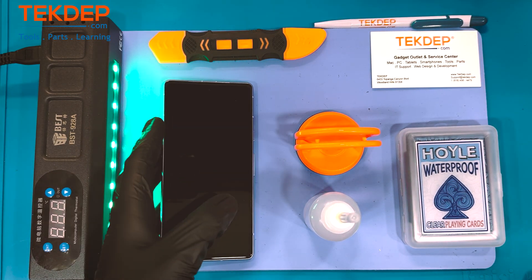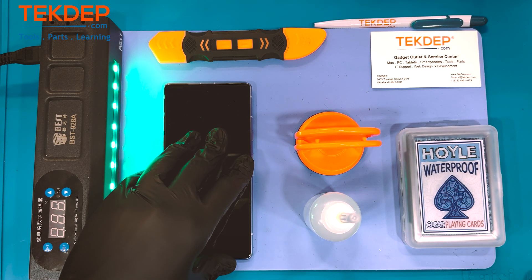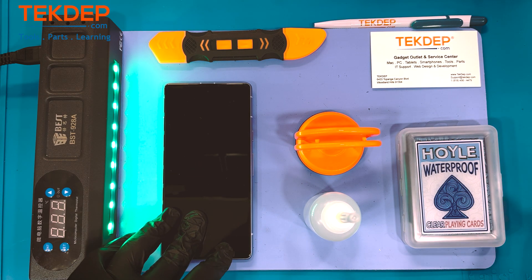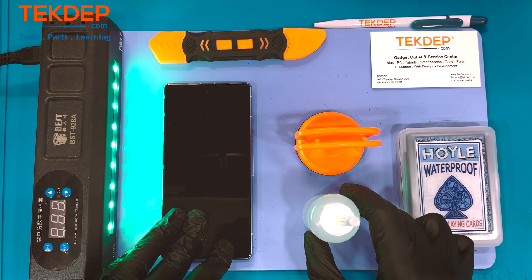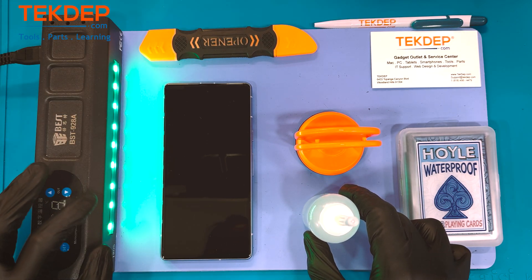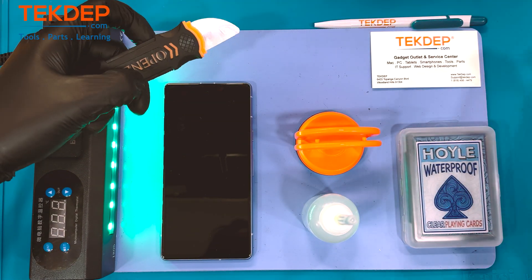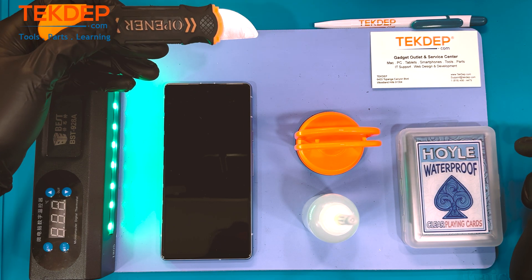There's a fragile screen, at least as far as repairability goes. The Gorilla Glass is pretty scratch resistant and pretty good when it's on the phone, but these OLED screens are finicky when it comes to getting them off without damage. So that's why we use the playing cards, the suction cup, the isopropyl alcohol, and that eye opener tool — that little metal spudging tool. Sometimes we use a bit of a flimsier piece of metal, the curved screen disassembler. This one is pretty rigid, but it gets the job done for this job specifically.